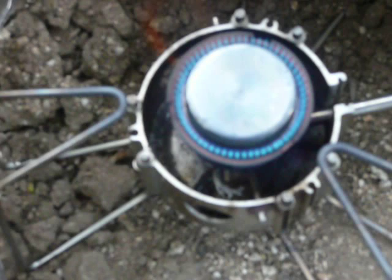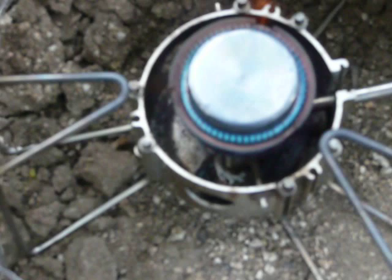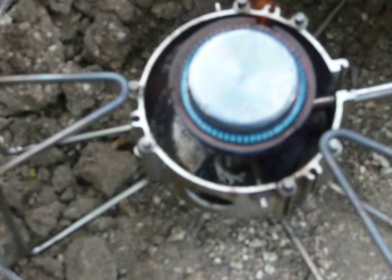From what I've read, it's actually more efficient to use a silent cap. The air to gas mixture is actually optimized better by the silent cap than the roar plate, although the roar plate would be better in a windstorm. So there we are again — very low simmer, not going into underburn. What a lovely cap. Can't ask for more. Well, that's all I've got for you today.